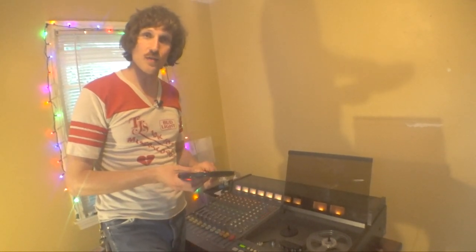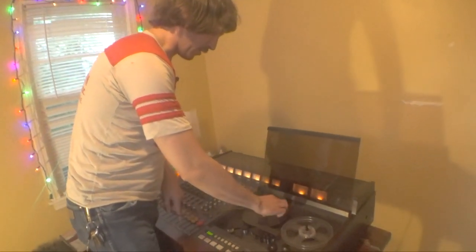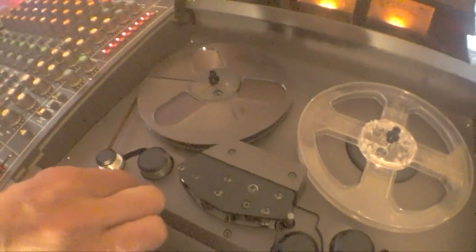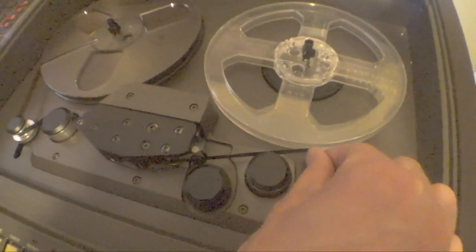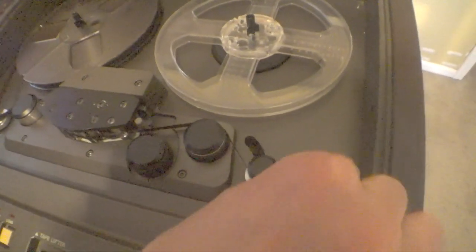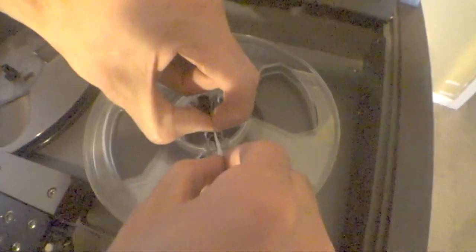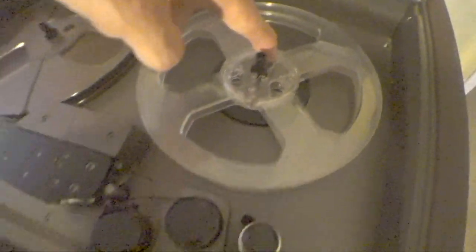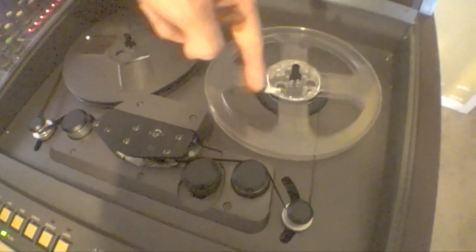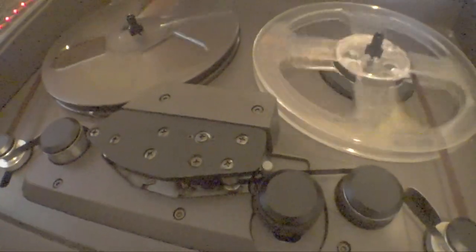In this day and age you're recording a band and it's going straight onto an audio interface and getting captured in a computer. So unless you're recording the White Album that you need preserved for all time, I load the tape this way: it goes over the tape lifter, over this roller, across the heads, through the capstan roller, around that tape roller, and around that tape lifter, onto your take-up reel. Pinch it through there, rotate it slightly, then hit play — boom — and it starts winding up.